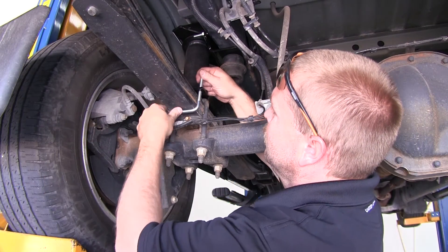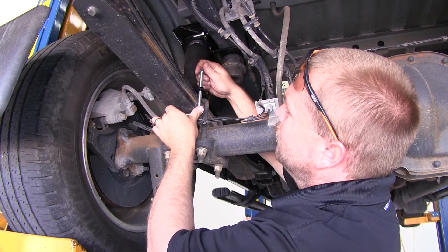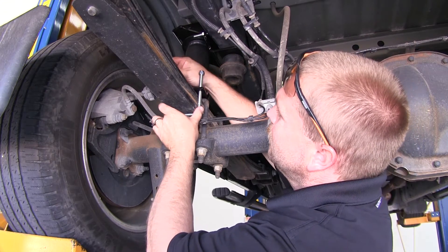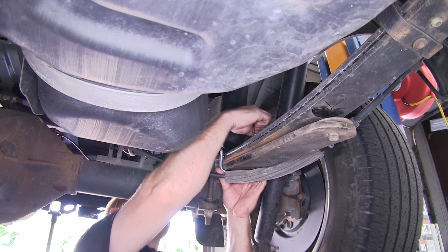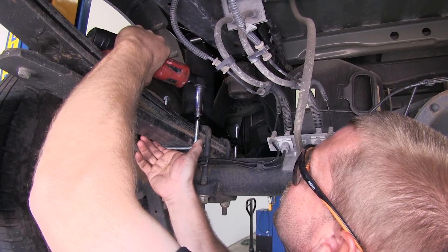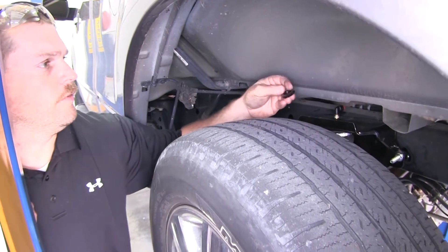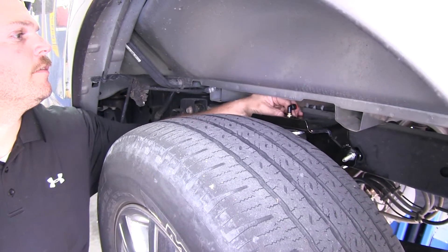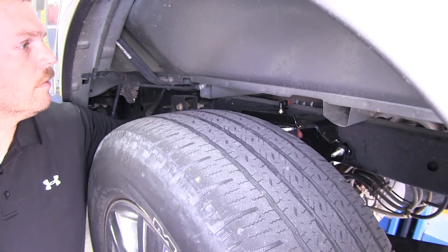Now we're ready to put the U-bolts that hold the lower bracket into place. The U-bolt will have a flat washer followed by a nylon nut washer put onto each one. Go ahead and tighten down all four of the washers and nuts. Then on top of the airbag or air spring, put the lock washer on top followed by the three-quarter inch nylon nut. Just hand tighten these a little past hand tight so we can still move them for final adjustment.